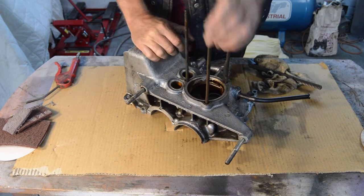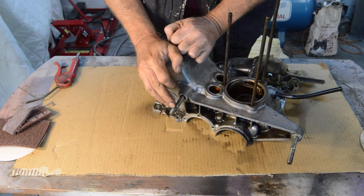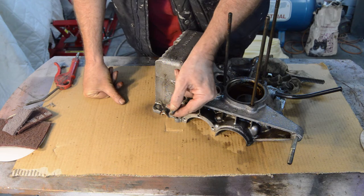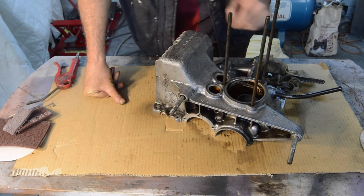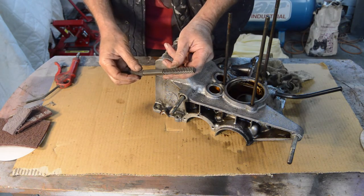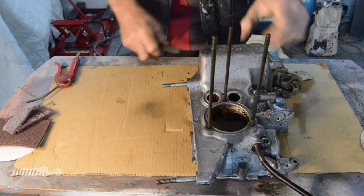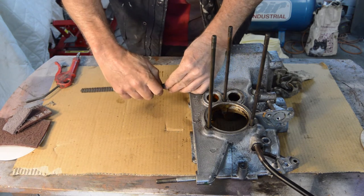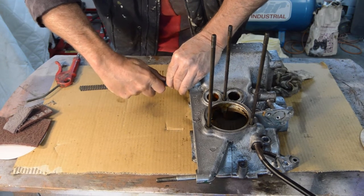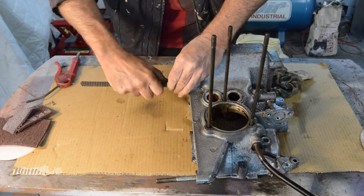This one isn't - it's suffering from typical clutch replacement damage where the engine has been bashed about against the gearbox. So I'm just going to check my thread file sizes. I'm not actually going to recut it as such; I'm just going to try and straighten out the rough bits, like that, which takes the edge off them.